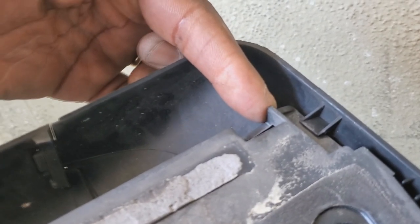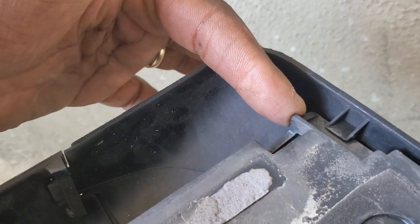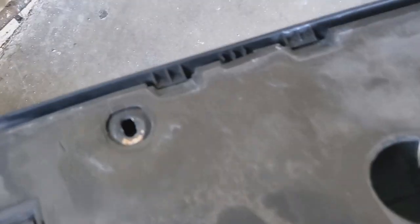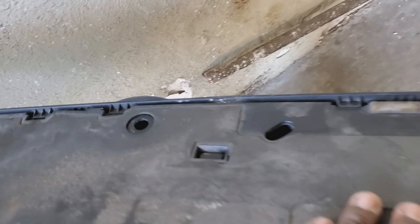So knowing the corner, a half an inch there, I'm also looking at this distance. And I wanna get a firm measurement to use so that when you have this on the top of your roof, you're able to determine that from here is gonna be a good even point and here is gonna be a good even point, to make sure, before you drill your holes in your roof, if you're going with the technique that I'm gonna be showing you today, that everything is proper. But number one is making sure it is inside of those grooves before you flip it over, okay? So now, I'm just gonna carefully flip it over and this will be a proper mounting position. I'm gonna clean up these lights a little bit later, okay?